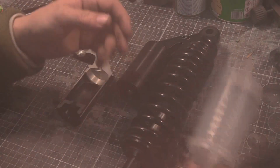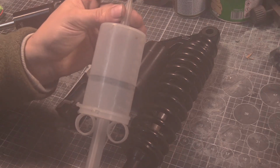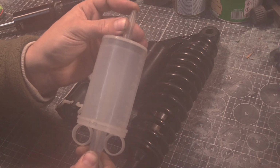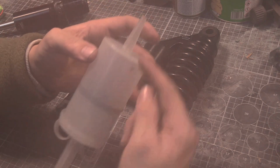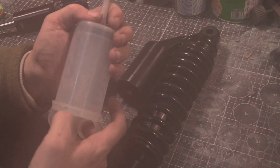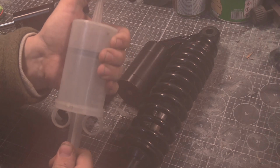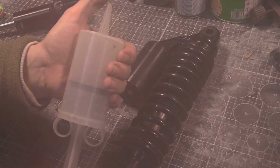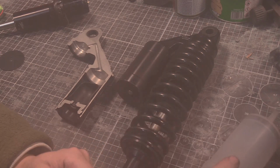What's more important is when the spring pushes it back, right? So we've squeezed our oil through here, but then when the spring pushes it back, because there's nothing stopping this, we half fill this with oil, but then there's nothing, right? We've just pulled a vacuum. We've just gone like that, and we've gone, well, this leaks, but we're pulling a bit of a vacuum before we pull the rest of the oil through, and that's cavitation, right? And that'll just destroy your oil over time.